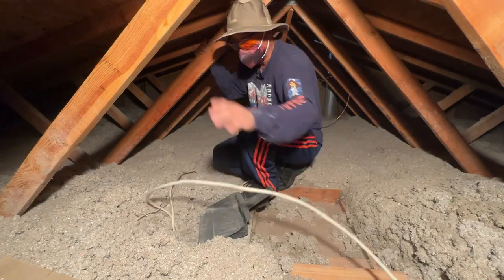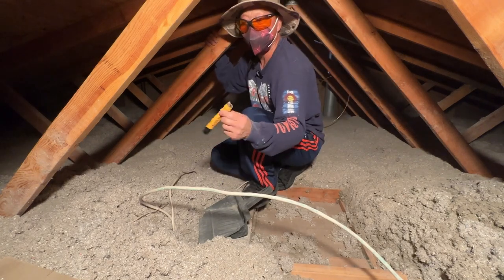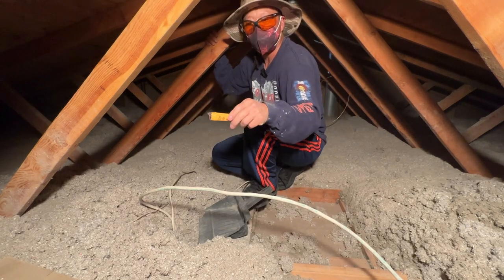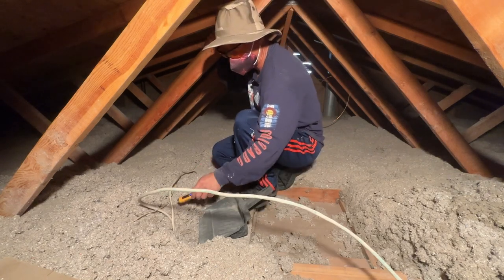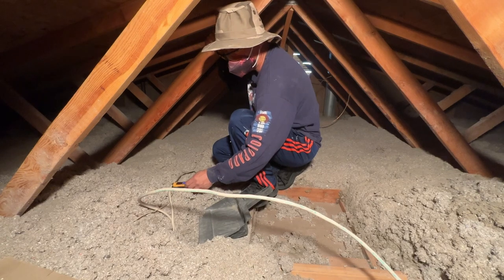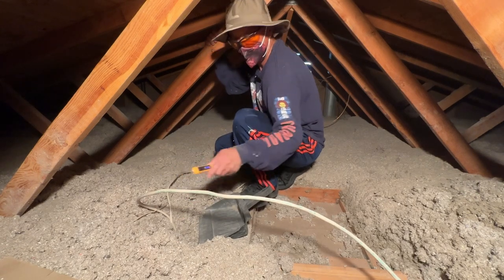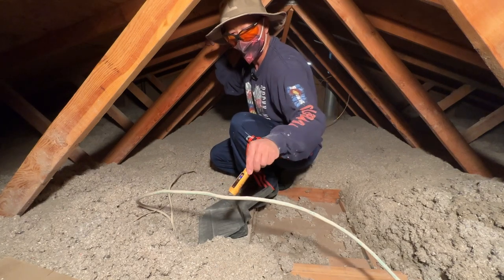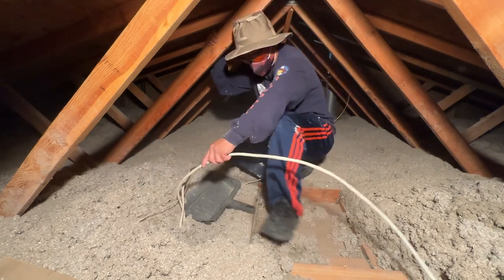It shows there's no power whatsoever on the swamp cooler wire. There's a little junction here — this wire is dead, but this other one has power on it. So the swamp cooler wire is about right here and I'm going to dig the insulation out of that area.